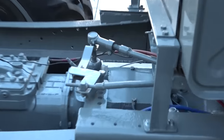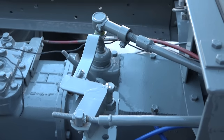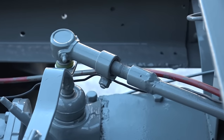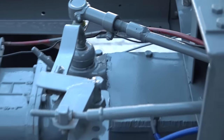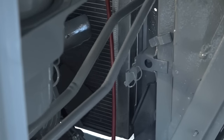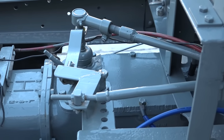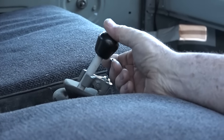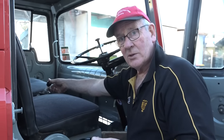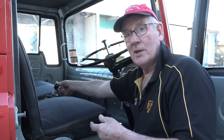The gear linkages in here — I'm not sure what to say, except that it works. If I reach into the cab and rattle the lever a bit, that's what we use to switch between selection of gears, and then we've got forward and reverse. It looks horrible, but it works. The cables from the Eaton diff are now connected to the controls for the multi — pull the knob up for high multi, down for low multi — so it works much the same as the original truck and gives us another three forward gears.